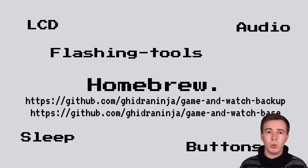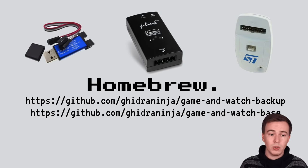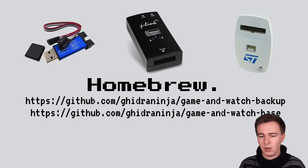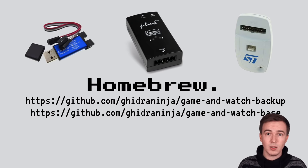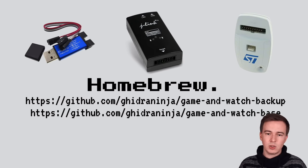Now, if you want to mod your own Game & Watch, all you need is a simple debugging adapter, such as a cheap $3 ST-Link, a J-Link, or a real ST-Link device, and then you can get started. We've also published a base project for anyone who wants to get started with building their own games for the Game & Watch. And so it's really simple. It's just a frame buffer you can draw to, input is really simple, and so on. And as said, we have a really helpful community.